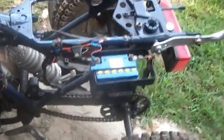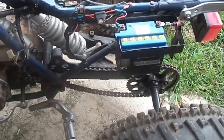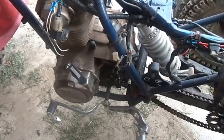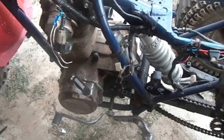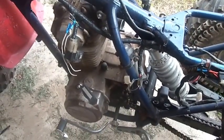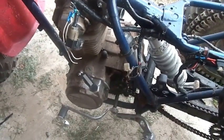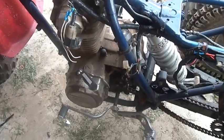What he did was put a 200E motor on it, hence the electric start. I took the 200E off and I'm putting on what I think is a 185. The 200E is electric start; the 185 is a pull start, and a touch smaller. I seem to be having more trouble getting the 185 in here than he had with the 200E — I would think they'd be more or less the same mount-wise, but I'm not finding that.